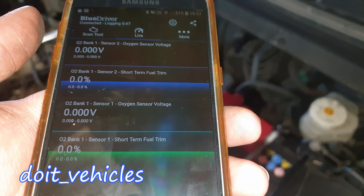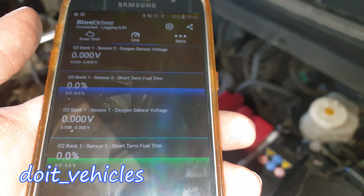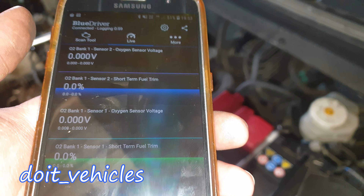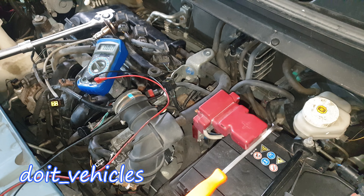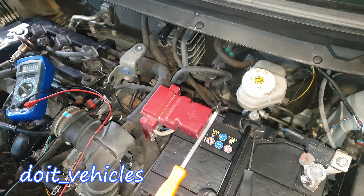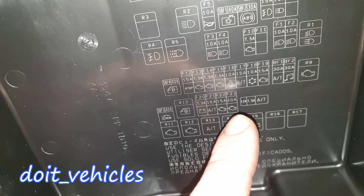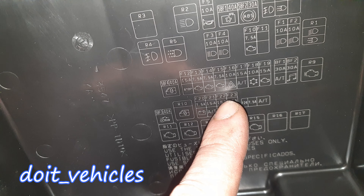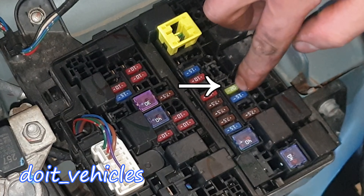As you can see, if you go back to the scan tool you cannot see any values even on sensor number 2 which is not disconnected. This car needs to be running in order to see values from most sensors. Another thing to mention: if you don't get power at the connector, you can check the fuses — usually fuse number 23, number 22, and fuse 19 are for the sensors.